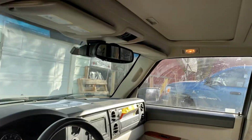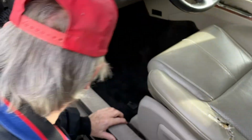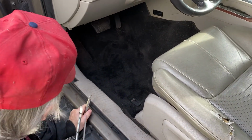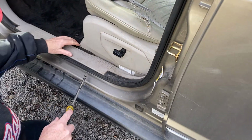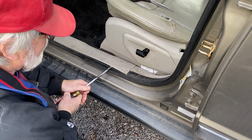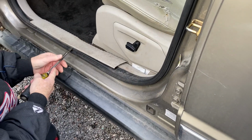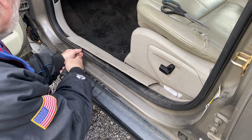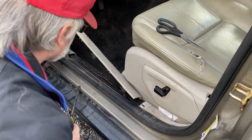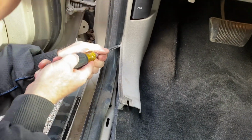There's a hose that goes from the sunroof down through here, and it's got a drain. We're gonna pop this up, pop that out of there, pop this up. We'll see the hose in here. Maybe I won't need to pop everything up, but it has little latches in here somewhere. Don't want to break them. There's one there. Take that, put it there. Should pop out of here.